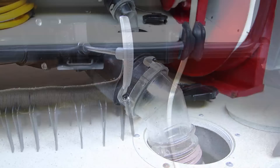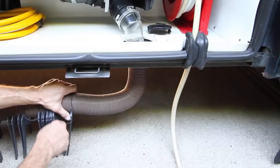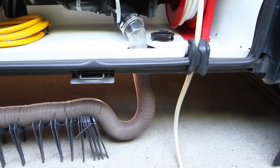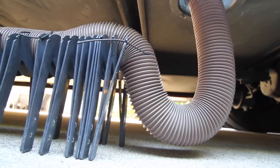If you'd rather forget about gray water during a long stay in one RV park, a recent RV travel newsletter shared the easiest solution ever for getting the best of both worlds. Simply leave a short section of your sewer hose hanging off the end of your sewer hose support directly beneath the RV. Water will accumulate in this small section of hose, creating your own whole-house P-trap — giving you the benefit of a full hookup site without having to dump the gray tank and without any sewer odor.